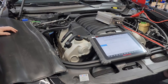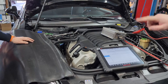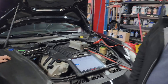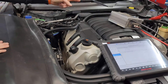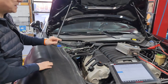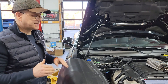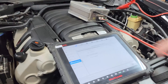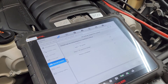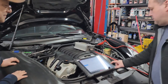We've reconnected the line to the strut and are continuing to balance the system. Right now the suspension control module is filling the empty strut with pressure. I'll comment on the power supply — during this process we need to make sure the battery voltage stays where it's supposed to be. The tool confirms it's happy with the suspension fill and the process is completed. We can now lower the vehicle and do the test run.